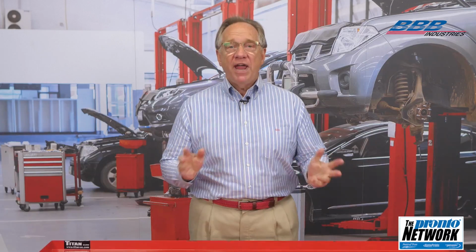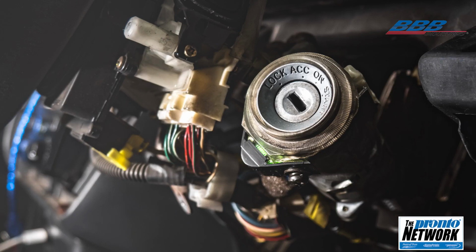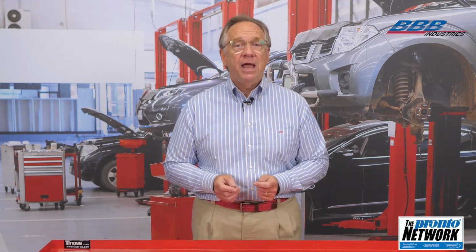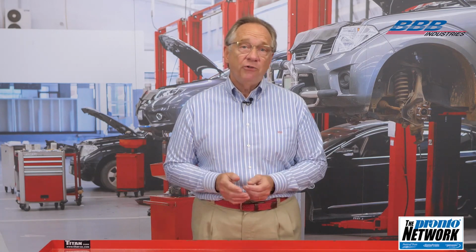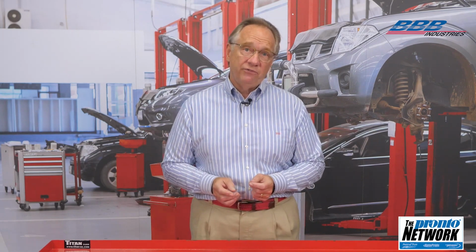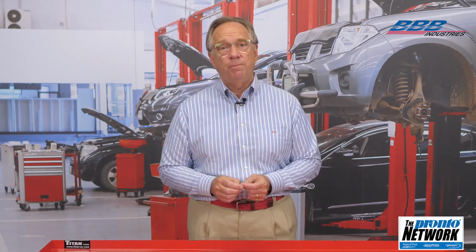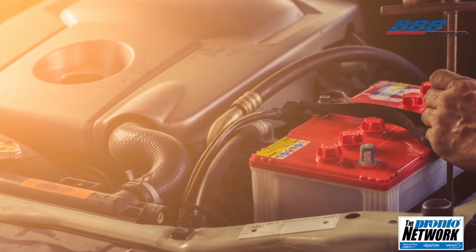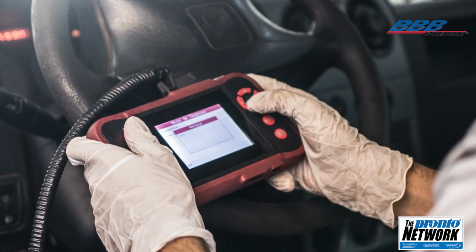Cranking problems can be caused by a number of factors: a low battery, loose or corroded cables or wiring, a broken or missing ground strap, a weak starter solenoid, a bad starter drive, a broken tooth on the flywheel, starter misalignment, a faulty ignition switch, a mechanical problem inside the engine, or even the wrong oil viscosity. The oil being too thick for cold temperatures can make it impossible for the starter to do its job. If a battery has been disconnected or allowed to run down, the anti-theft system may have lost its memory and will have to be reset with a factory scan tool before it will allow the engine to start.